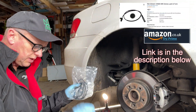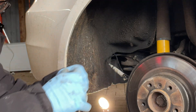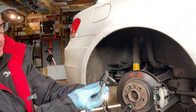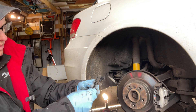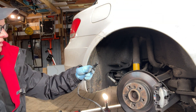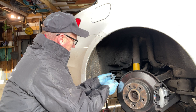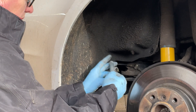I've been online and got a new sensor — that's the old one, here's the new one, I'll put links in the description. The sensor looks really good quality. Let's compare it to the old one to make sure the dimensions are the same. The original is an 80E sensor — it's got it stamped on the back — and lengthwise, perfect. Everything looks as it should be. Let's get it fitted. We'll connect it to the plug first — it should only go in one way. The line lines up, it slides in and clips in nice and snug.